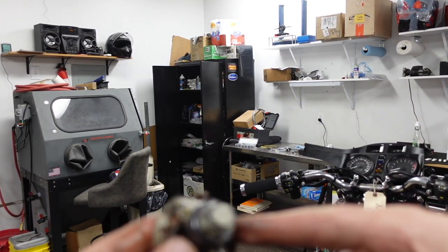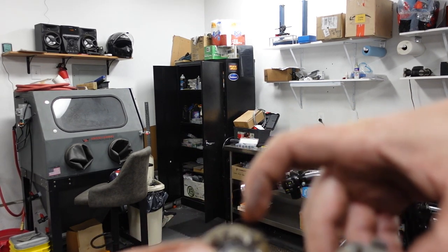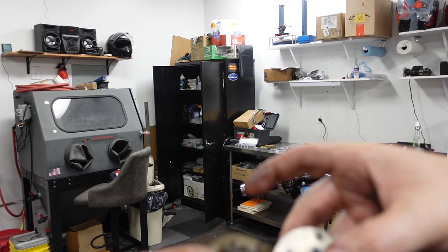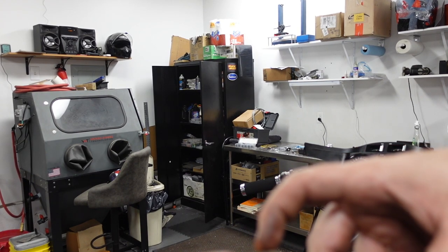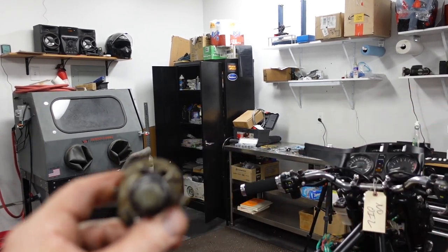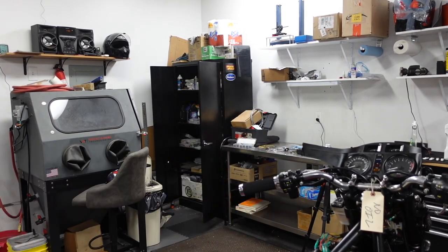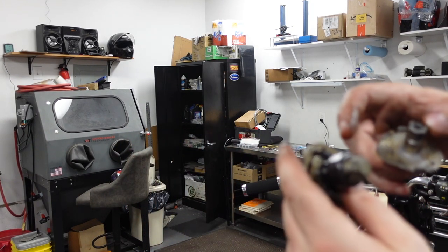you see how this has 2-3 TF, and then there's lines right here. So the top dead center, fire, and then the advance mark for 2-3. And then you got the same thing on 1-4. I don't know if you guys can see it. Is it focusing? Well, you have to trust me.